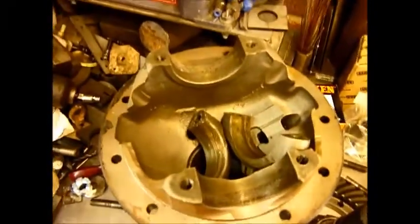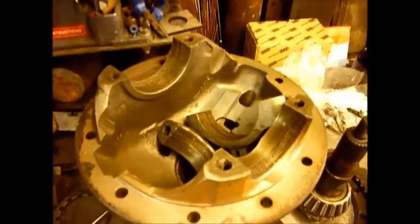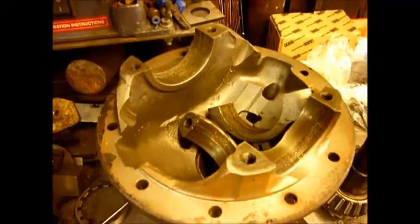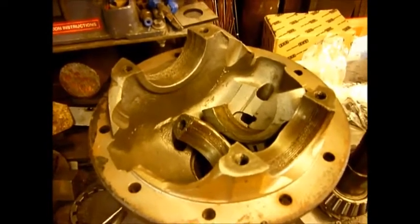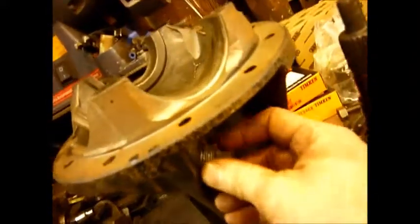This one I've had in stock for quite a long time because it's an Imperial case and we don't use many of them. On a 10 spline diff it could be fitted to either an early 90 or Range Rover with 10 spline axles, or to a Series vehicle. On those you've got to be careful you don't end up unable to get oil into the axle, because on some vehicles the oil filler is in the diff pan and on the early Imperial axles like Series, a lot of them are in the actual casing. Yours truly many years ago did fit a metric casing to a Series vehicle and then found you couldn't get any oil in the axle.